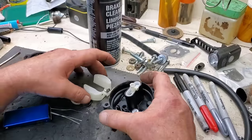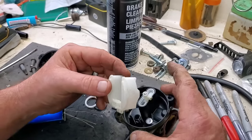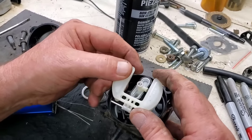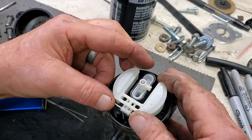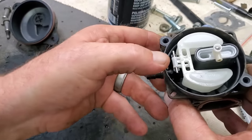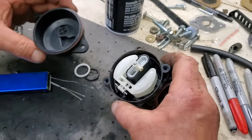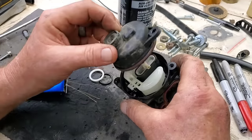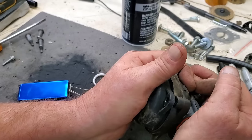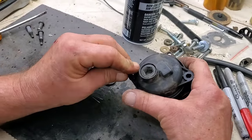Rocking on. Needle looks pretty good. Lining that back in — sits right down. I'm going to take my thumb. Have y'all seen the 'Fix a Plastic Carburetor for Free' video? If you have, let us know down in the comments, because I've got a video that's very detailed on this carburetor. See me just push that down on that O-ring? I'm going to take a screw right here.